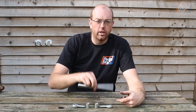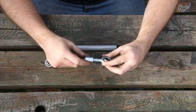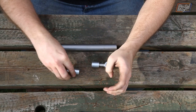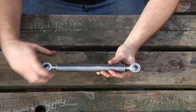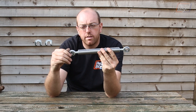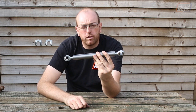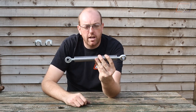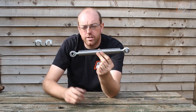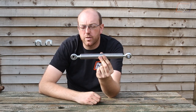Essentially this is our suspension arm — at least one of the four we need to make. We have a piece of tube and some inserts; the inserts go into the end of the tubes and allow the rod ends to key off. Thread them on and push them in and that's basically a suspension arm — adjustable at both ends. As you spin it the length shortens point to point, and that's how you adjust toe, camber, and alignment generally. We just need to make another one, measure up for accurate lengths, then weld in the inserts — though the other arms are going to be a lot harder.